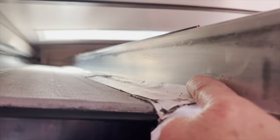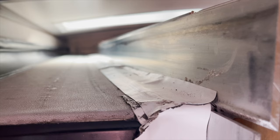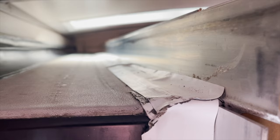go a little bit above the top here and come down and go past that line. So again, coming above the fascia and coming down and going past it. And that'll prevent any water from getting in there. And again, this tape was produced sometime in 2019. So I'm gonna say that it's close to 4 years old, or 3+.